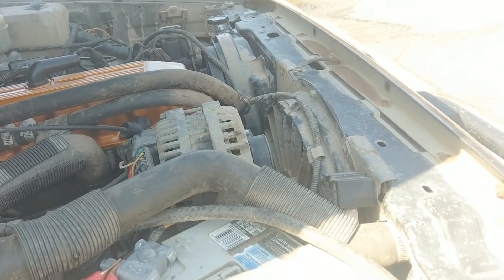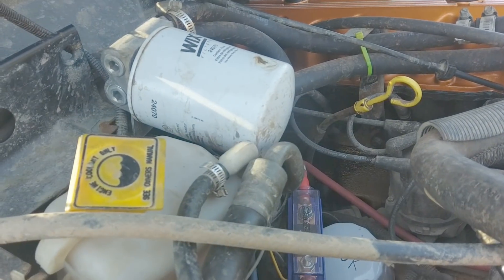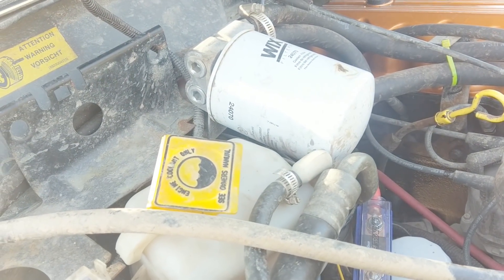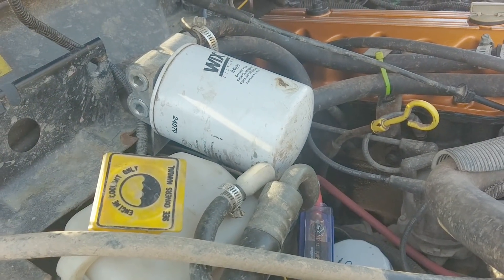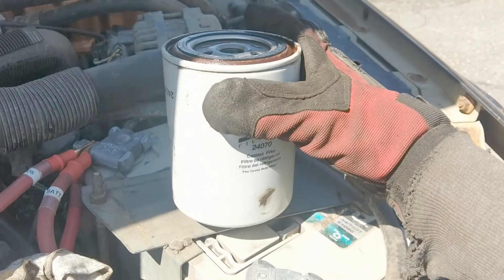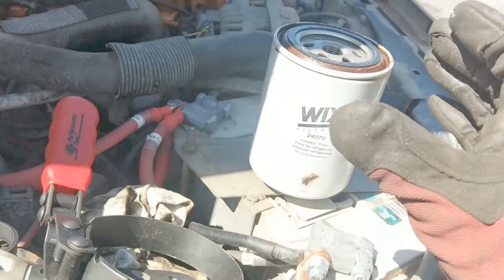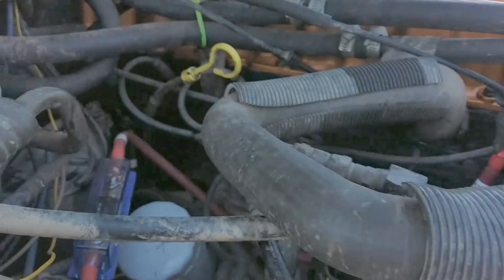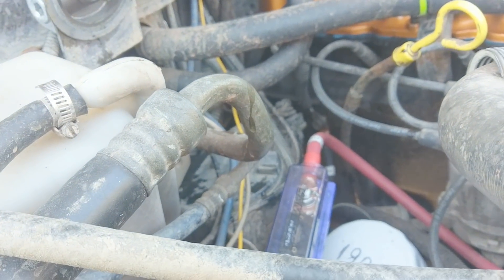Since I'm going through the cooling system anyway, might as well pull the filter. First I want to flush the heater core and see if anything actually comes out, and two, crack open this filter and see what we've caught over the years. The fun part's gonna be trying to twist that off. Got the filter off — needed one of these guys to actually break it free with some WD. Some coolant in there, not a whole lot came out, but it's because the thing's basically drained.